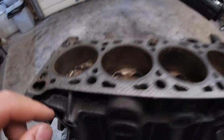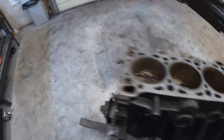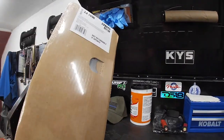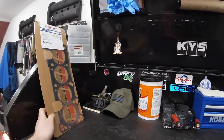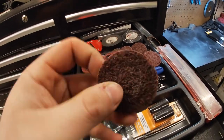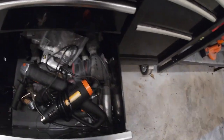Alright, starting with the head gasket. We have this layer of texturized head gasket material on here. I always use these Fel-Pro gaskets from AutoZone — they're pretty good. I used to work at AutoZone. They haven't failed on me yet; I've had them on every Miata I've built so far. The way I like to clean the head surface is with these little red wizard wheels. I'll take one of those and my air gun, clean off the whole head. I'm going to run a little time lapse of that.